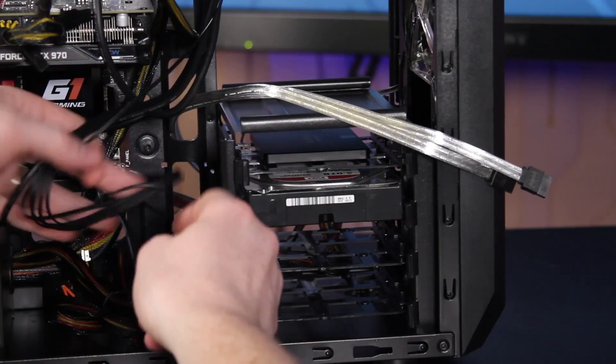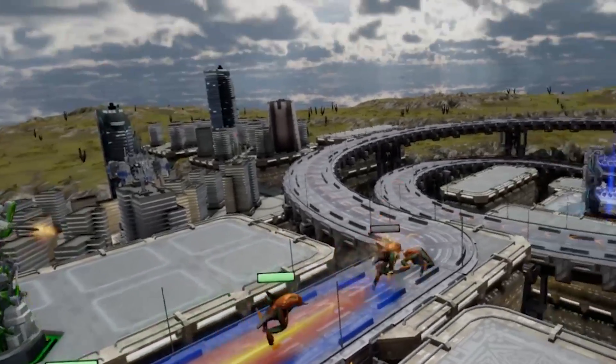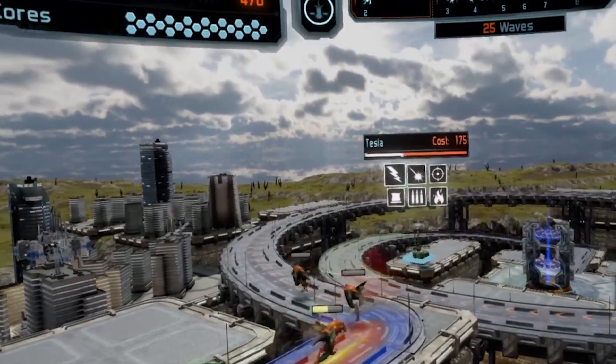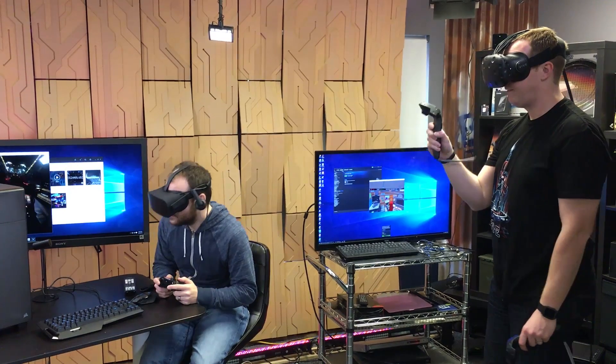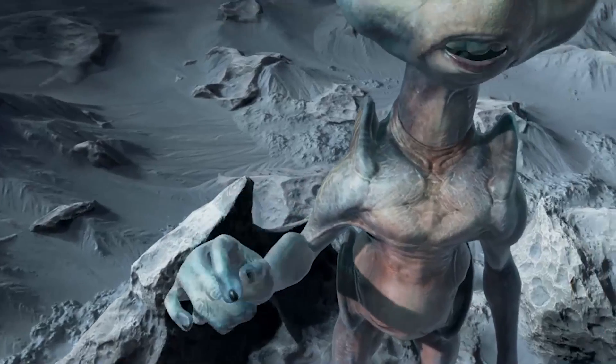So this is the finished $900 system. We ran the Oculus tool and that gave us all green check marks straight down the line. Then we ran the Valve SteamVR tool, which is not just a check — it runs you through a basic system stress test. We got a score of 7.1, which is listed as 'high' by them. It puts it squarely in the middle of the green area of that spectrum where you are ready for VR. We were able to play on the system and confirm the results. I was surprised at what we found — but maybe I shouldn't be, because this is aimed at the minimum spec that Oculus said you need for a good VR experience. And shock of shocks, we had a really good VR experience.